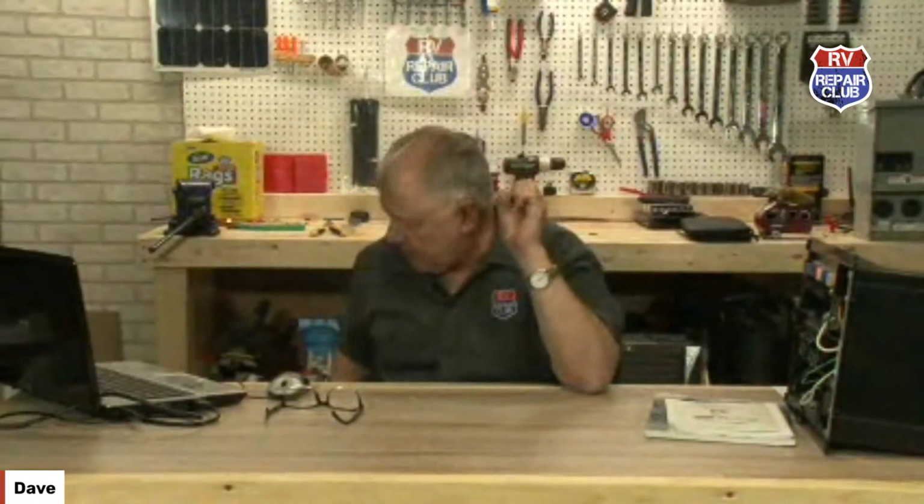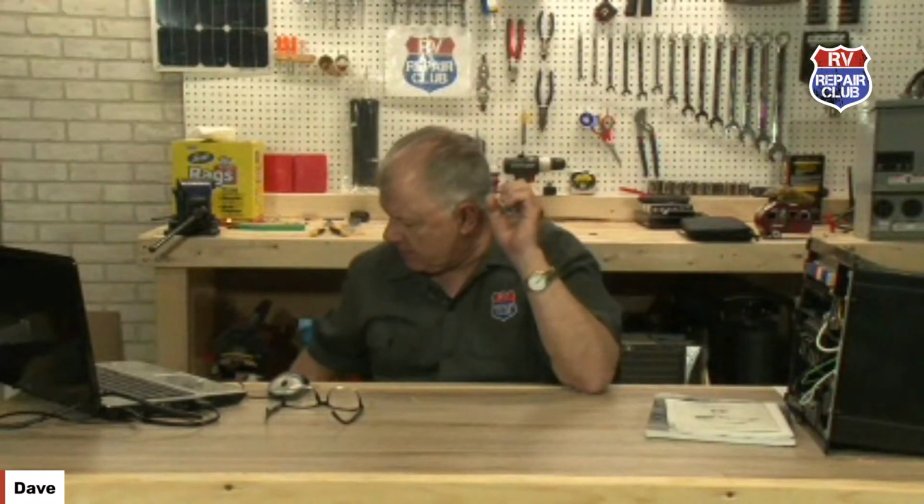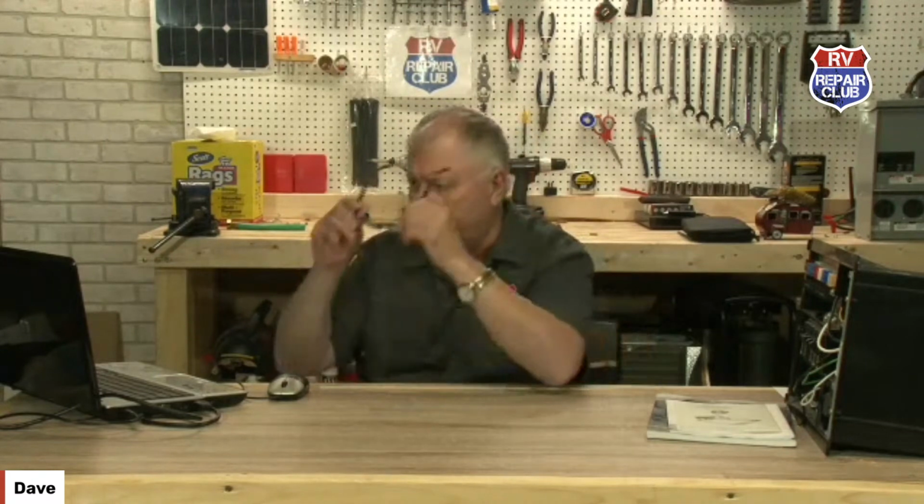The only way you can fix that back wall is to basically take that exterior fiberglass off, and that is expensive. That is very expensive. So you might be able to get by without doing that. And I don't know what that moisture damage looks like, if it's started to delaminate and you got big air pockets in the back, or what. But that's how it's manufactured. So if you can do a little bit of digging and find out, you have a better idea of how far you got to go to get that fixed.